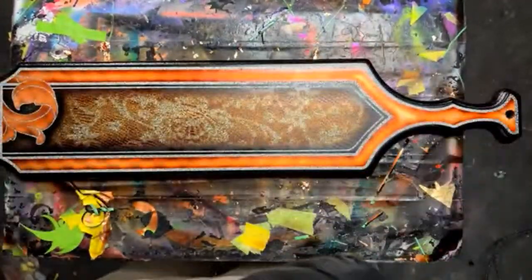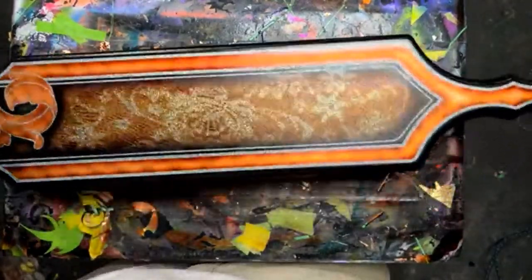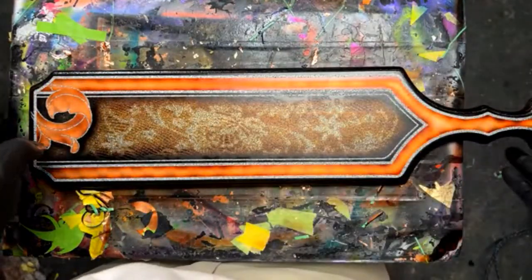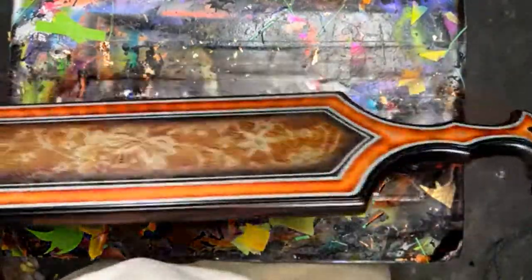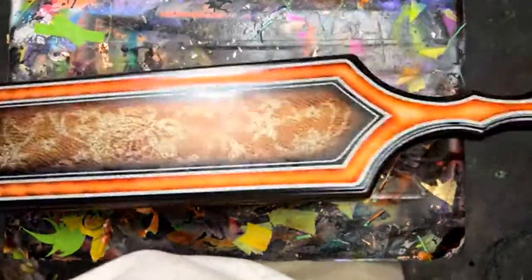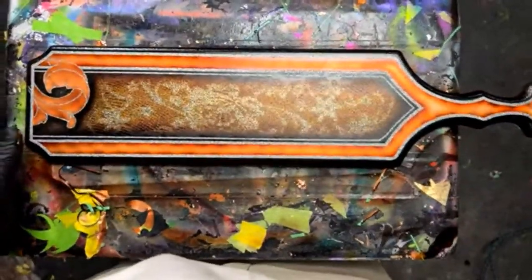If this was, say, a motorcycle part, you would want to clear coat this piece with 3 to 4 coats, sand it down with 600, 800 grit, 1200 grit, whatever you want, and then re-clear it again and give it that flow coat. I might still do it with this. We'll check it out and see what it looks like after that first go around of clear coat. But it might make it through and look good enough for what it is. But okay, I think that's it.